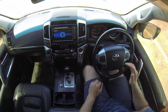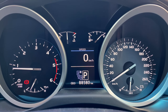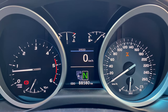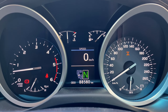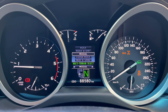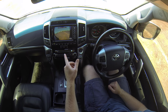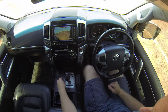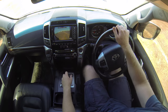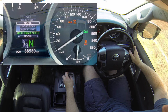When going off-road, the first thing you want to do is activate your centre diff lock by pressing the switch by the driver's right knee — you'll see the light illuminate on the speedo side of the dash. Next, chuck it into low range by switching the gearbox into neutral and then turning to low range using the button — push it in and turn it across. You'll notice your anti-skid turns off, you have your four-low indicator on the dash, and a camera pops up on the main screen on the VX and Sahara models. That screen also has two lines indicating where your wheels will be placed, and they change as you turn the wheel.